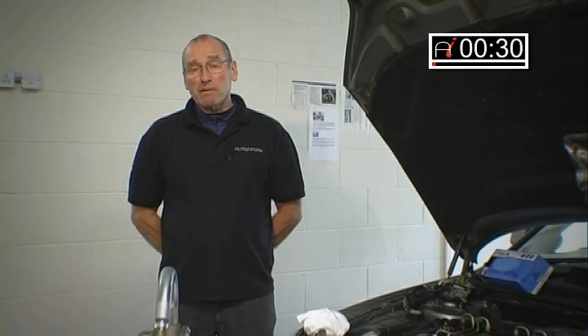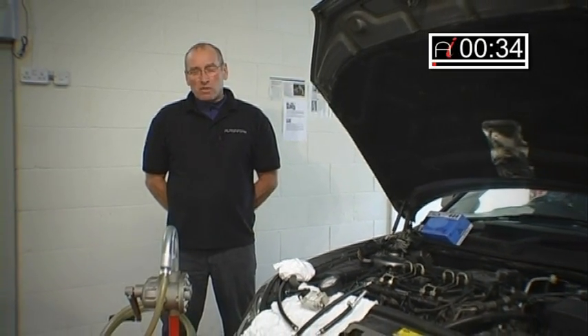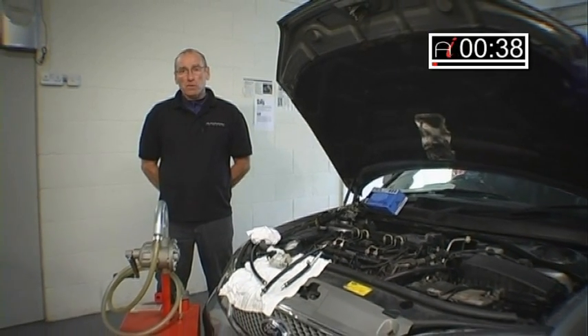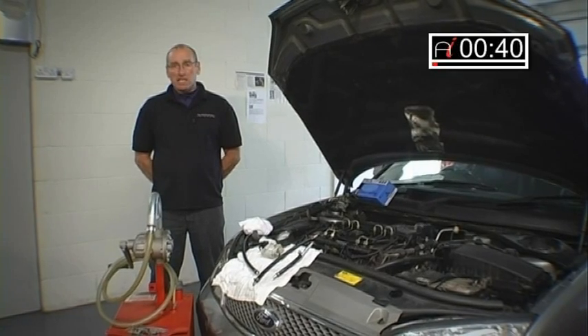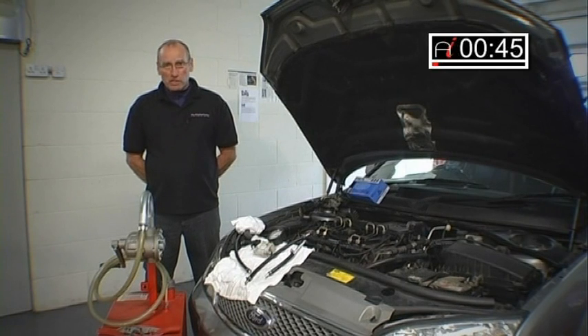It's a problem we've come across a couple of times in the past. We've struggled quite badly following major repair work — perhaps a change of injectors, perhaps draining the fuel tank, even basic servicing where priming the fuel system has created a lot of difficulty. One of the dangers of cranking a vehicle without fuel is that you're actually rotating the high pressure pump without lubrication, something which should be avoided at all costs.